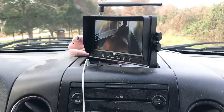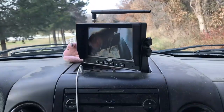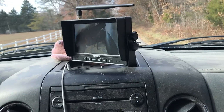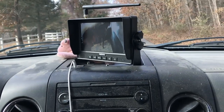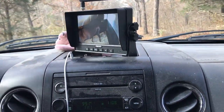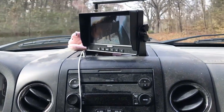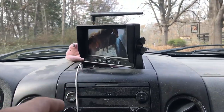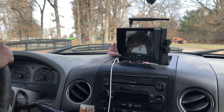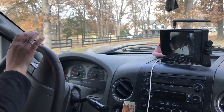There are a lot of other cool things you can do with this camera that I don't have set up. You can expand the system with more cameras — maybe in the future we'll put a camera on the back of the trailer to help back up when it's connected to the truck. There's also an option to put a camera on the back of the truck to make hooking up to the trailer easier. If you want to get into the wiring a little more, you can tie in the reverse function of the vehicle to a certain camera, so when you place the transmission into reverse the camera on the back of the trailer or truck comes on, and when you take it back out of reverse that camera disappears. Anyway, I hope you guys found this video interesting. This has been something my wife has really enjoyed and benefited from, and again thanks to Halo View for sending this to us. We like it and maybe we'll expand with another camera, but we're pretty happy with it.